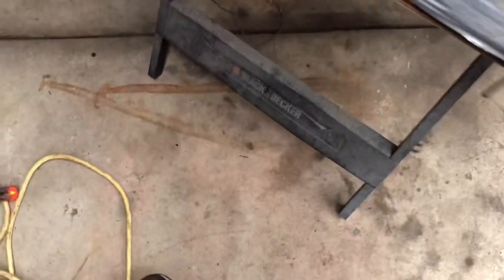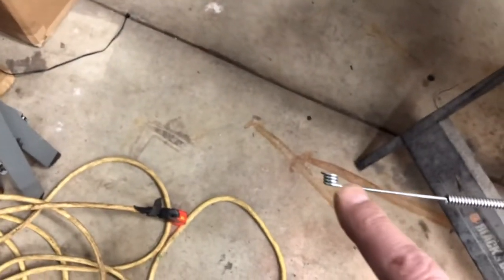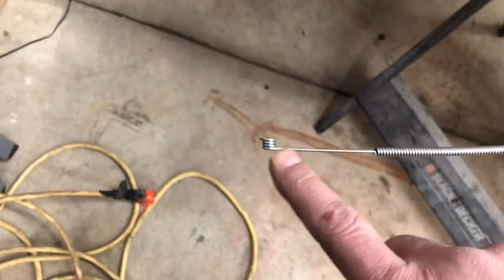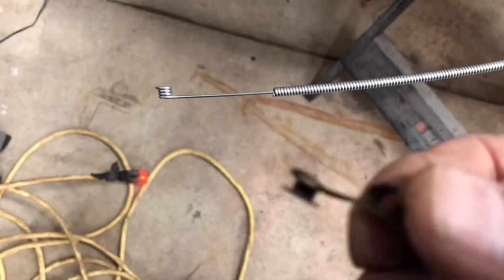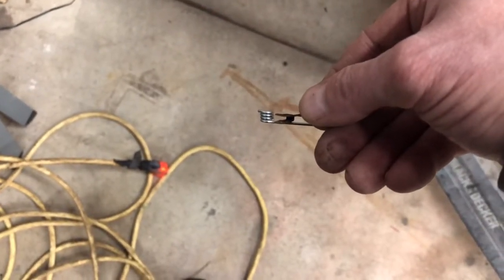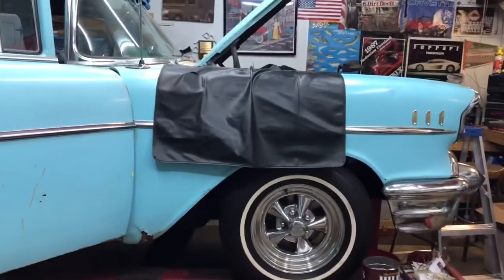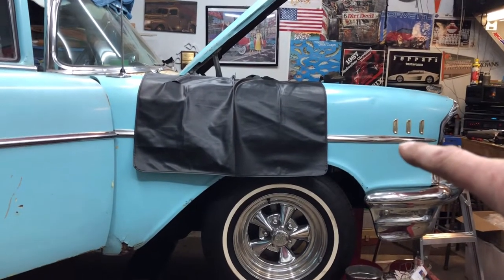This goes over top of the rod on top of the flapper valve and then slides over to cinch it down. If you're replacing these, I suggest you buy new clips — they're kind of pricey but you'll wind up breaking the old ones taking them off. Because the new cables come with multiple coils, you're going to have to take wire cutters and trim them so the clip will fit on the end. That's the only place where you'll have to cut them down — on the ends that connect to your vent flappers on both sides.